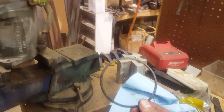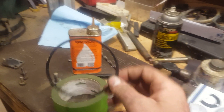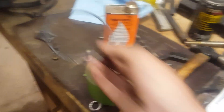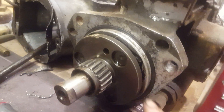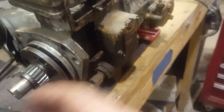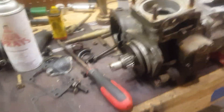Now they're just nitrile O-rings — they're referred to as packings in the nomenclature, but they're just O-rings. O-rings over years and years of heat and oil exposure flatten out and harden up, and that's what causes them to leak. As you can see here, this one is nicely flattened, and this was on the front of the pump. If you look down here, there's a groove here and that groove is what the O-ring sits in. You've got the same thing here. Once the O-ring flattens out and there's no longer any pressure exerted against both sealing surfaces from the O-ring, they tend to leak. It's a lot of work to take this all apart when it's on the truck leaking again, because you've got to remove the pump from the truck if you want to do it right and not mess anything up. So I'm doing it now.